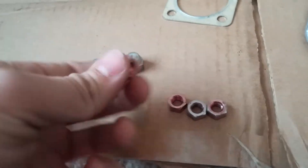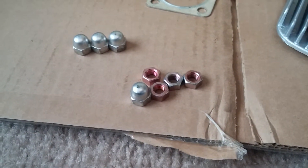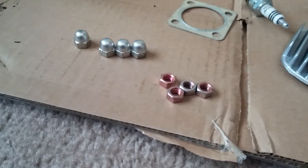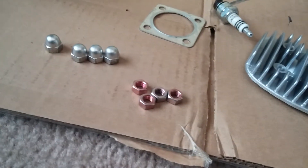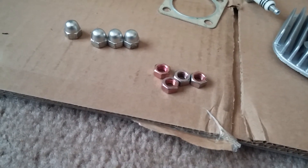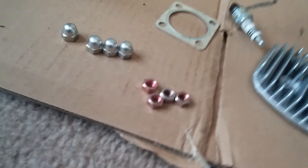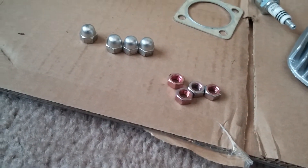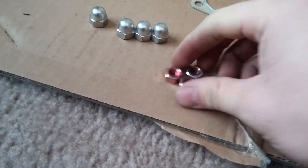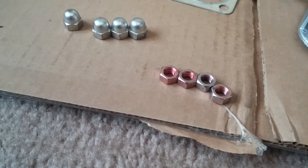So what I like to do is just get these and upgrade them. It doesn't look as good but they'll last quite a bit longer — you can take them on and off without them stripping out. It's just something that will help you keep your motor together and increase longevity. It's a cheap upgrade to make sure you don't have compression loss from an air leak at the very top, which can be bad because you could be sucking in air from outside on top of your cylinder wall. It'll make sure the head stays down tight — it's a real cheap, quick fix that lasts forever and is good to keep in mind whenever you're getting into the motor itself.